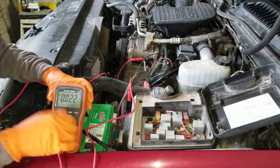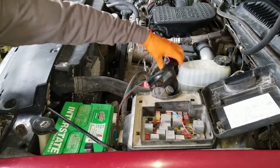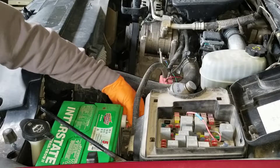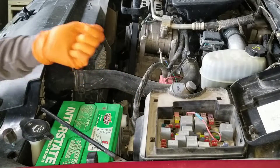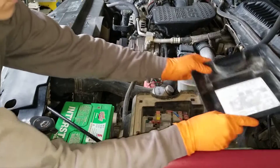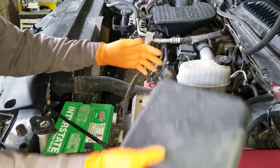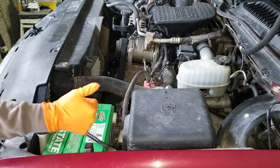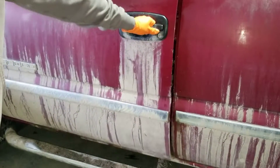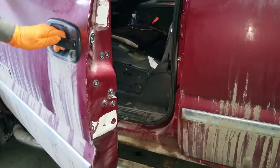After you've found and repaired the problem, turn off your multimeter and pull all the wires out of the truck. They're easy to roll up and there's a link for them in the description. Take out the bolt if you used one, or your vise grips if you used them instead, and just reconnect your battery cable to the battery — snug it up but not too tight. Close the fuse panel after making sure all the fuses are right in there, then carefully close the hood. Your door still reads as closed according to the vehicle but you can't actually close it, so while you pull on the door handle, take a screwdriver, push the latch back, and the door closes as it's supposed to.